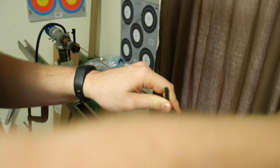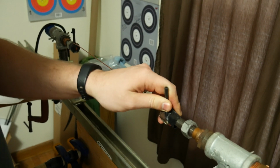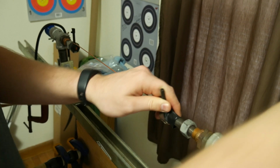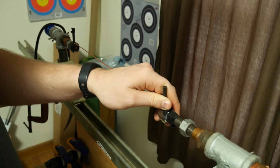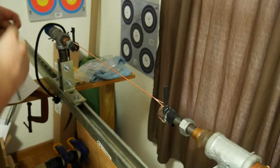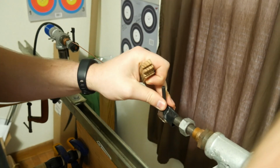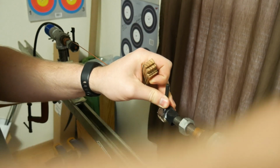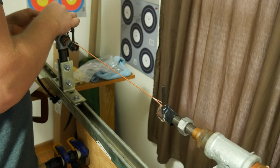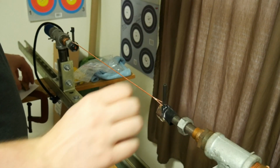Alright, so now let's back it off to 100 pounds, and I'm going to check my length. Anytime you're checking against the manufacturer's lengths, what they should be, that's always measured at 100 pounds from post to post. So check with my gauge here. Still a little much. Take a little more off. Just about one more twist. Okay. So we're right at 100 pounds now,